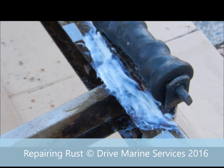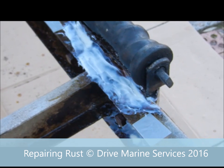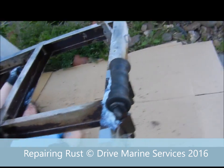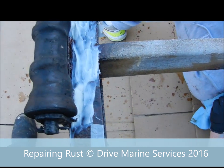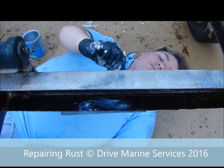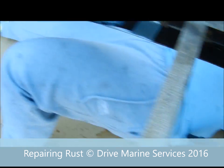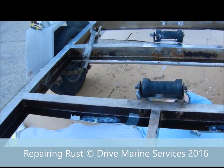In some areas we had holes going right through where it rusted all the way through. I've mixed up some epoxy glue and put some duct tape underneath to make a bit of a dam, then just lathered it on. Because it's thixotropic it'll sit where you put it. I've done a few other spots as well — over there and this side too. Once that's dry we'll give it a sand back, put some paint on it, and we'll be the only ones that know there were holes there. Beautiful.